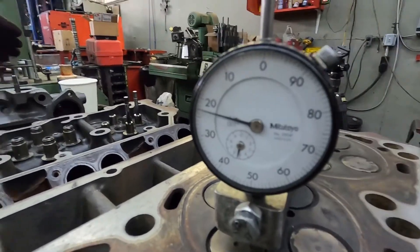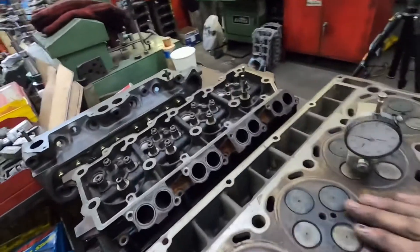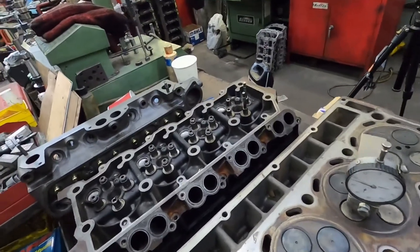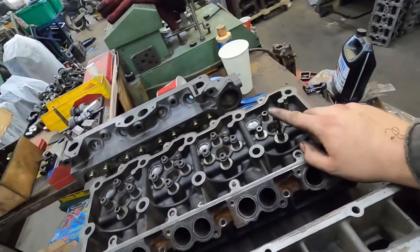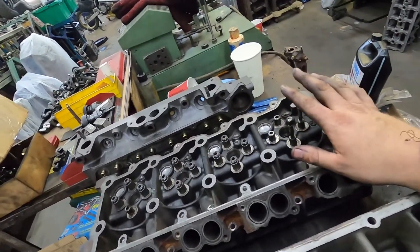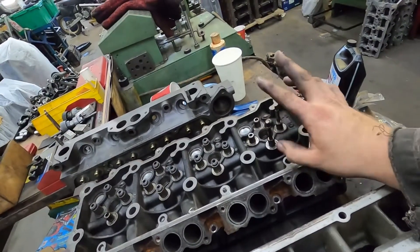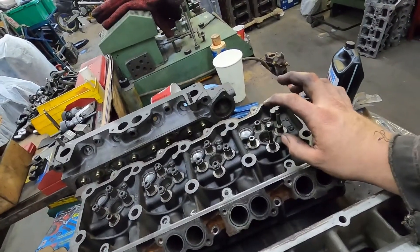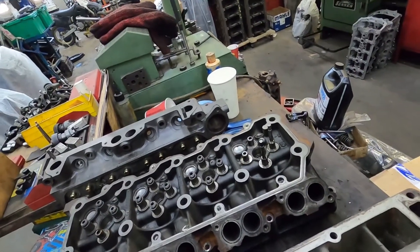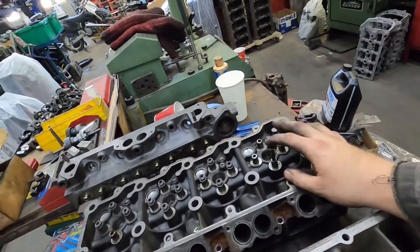You're supposed to be between 13 and 27 thou. On that intake we're at 24, so we're good. And 23 on that one. What you have to really watch on 6.0 liter stuff is if it's had a valve job, make sure the stem height isn't too high. If you have a big lift aftermarket camshaft and your piston protrusion is too high, you'll smash pistons or indent pistons and bend valves — not a good day.